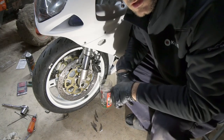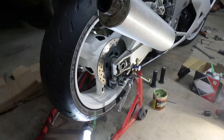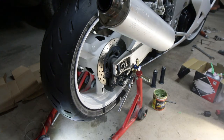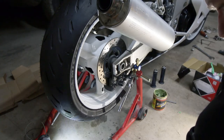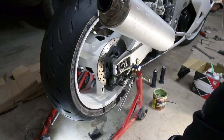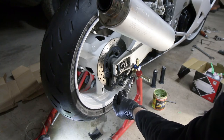Alright, that's the front done. Let's get around to the back side. Off camera, I went ahead and started playing around with this rear caliper. Basically you're going to have to remove the caliper off of the disc, just like on the front, but it's a little bit of a different system. There's a couple of extra clips, keeper clips, and a little bit of a boot that goes underneath here. This clip holds the pads in place — it's similar to that cotter pin that's on the front.